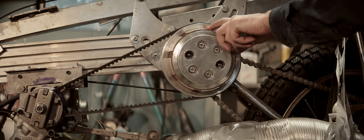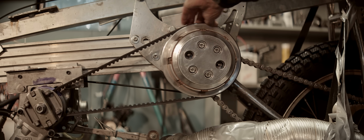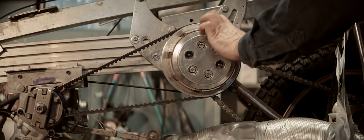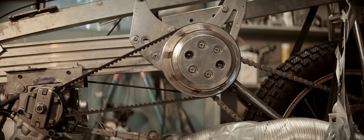And yes, the clutch must have had an effect during the coast down run, even though it was disengaged. There's still friction in there, so a little bit. So let's call it crank horsepower then. Belt loss equalizes clutch loss in neutral. Belt loss is probably much higher, but just to be conservative again.